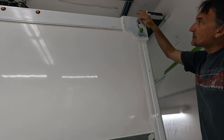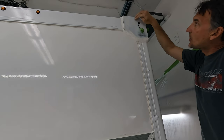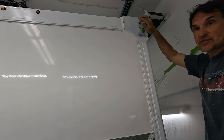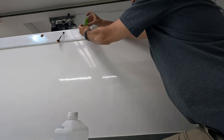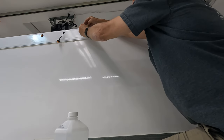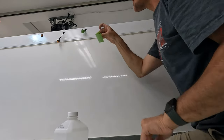Once I get these in place, I need to do a little bit of finish sanding right around the hole to make sure I've got good adhesion — I took the oscillating sander all the way around as close as I could to the light when it's in place. Now I just do a finish right around there, making sure good adhesion all the way up to that hole, then clean up the entire camper when that's all done. Just fold the tape right around the light and get it really well protected — it just takes two or three inches of tape, and voila, all sealed up.